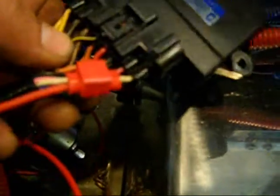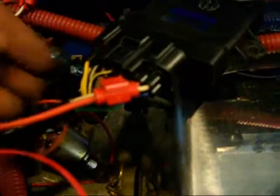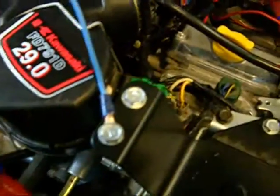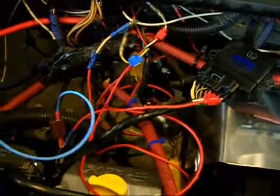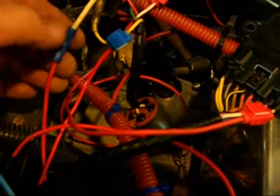Here's where it was getting tricky. This white wire in the corner is key-on battery positive. These two blacks in the back are grounds that are already grounded to the engine — I checked it. This Packard connector where my finger is, where I got the blue wire — this one was tricky because I had to take the center of this one and run it to ground. I'm going to put this stuff in a better location; I was just trying to get it going. I'll move this stuff and harness it up cleaner, with conduit and tape.